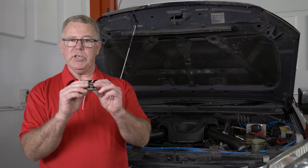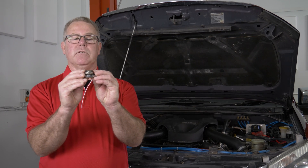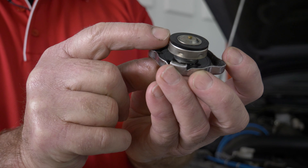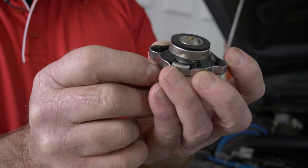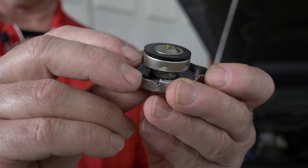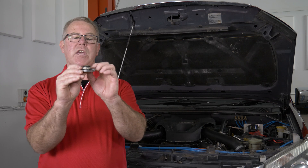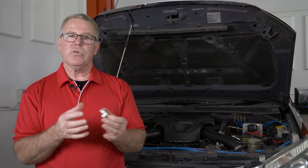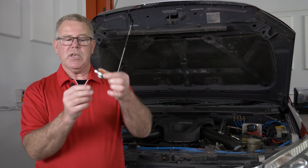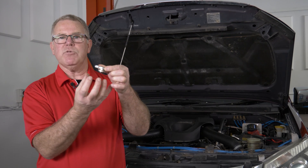However, the pressure release valve is very common to fail. What happens is that rubber seal gets soft and it expands and goes over the side of that metal flange. So it should just come like this one, just level with the edge of that metal. If it goes over the edge, what happens is when the cooling system heats up, it expands, the spring compresses, but the excess rubber jams the pressure in there.